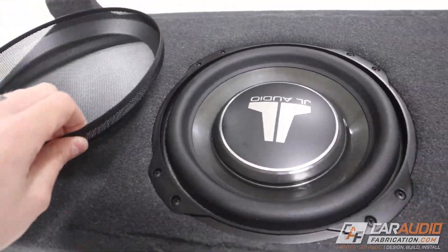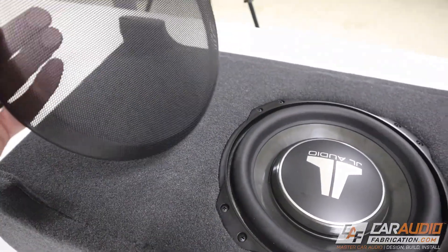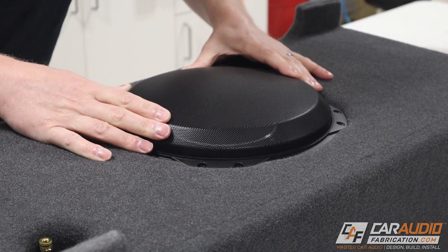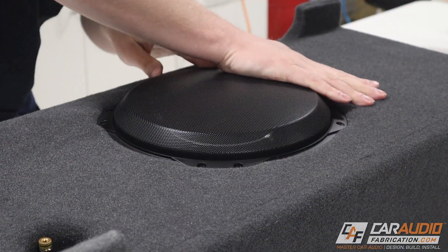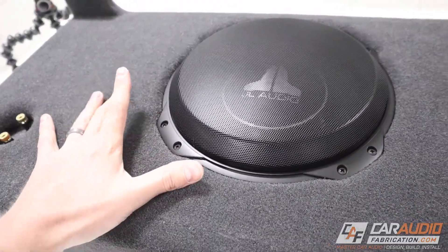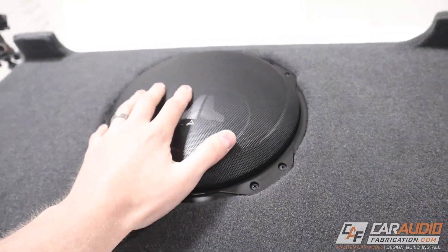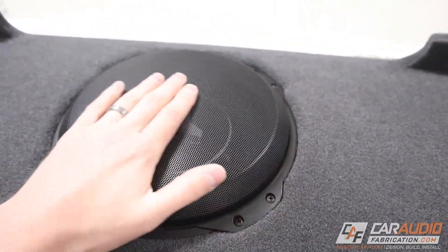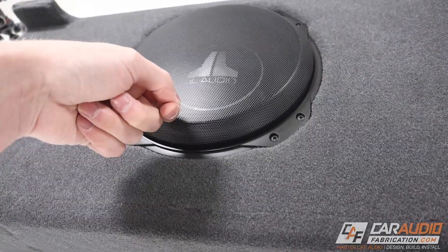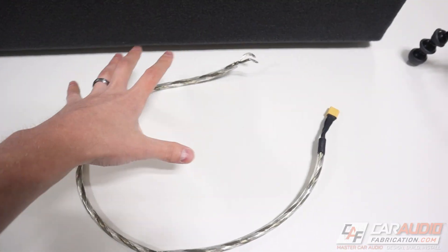What I really like about the JL Audio lineup is they make their own grills out of expanded metal mesh, and it's not like a separate grill where you have to drill new holes and mount a huge monstrosity around the outside. It actually integrates as part of the speaker with a press fit around the outside — held in place really well with no added fasteners that could potentially rattle. It completely protects the subwoofer. If you ever need to take it off, you can use a dental pick to carefully get inside one of those holes and pull against the speaker — it will pop off with a little force.